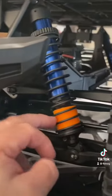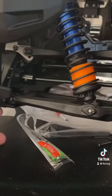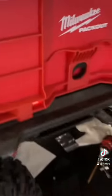So I made this little 30 millimeter spacer — this is made of TPU — and it limits that travel so it's not going to go any lower than about two inches, but I'm still going to have my suspension. I'm just going to be limited as to how far down it'll go.